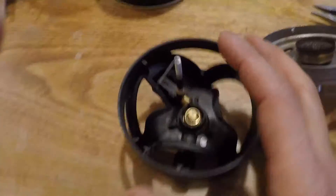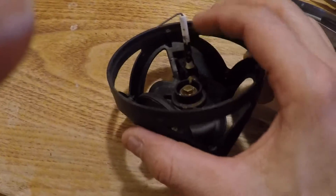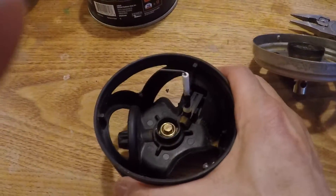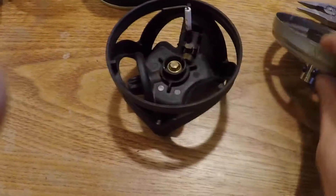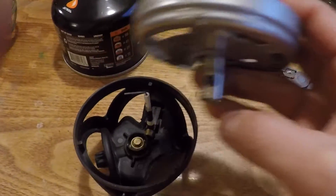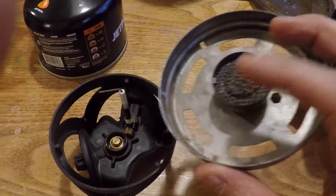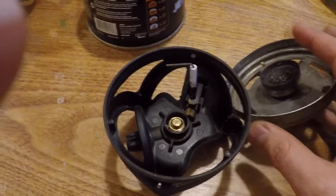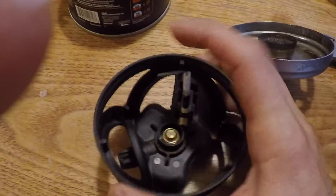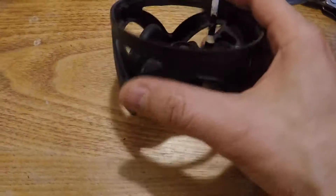That leaves the piezo exposed. This ceramic housing — if the ceramic cracks, what will happen is the spark when you go to hit the piezo will arc out where the crack is and hit on the inside or underneath the metal tower, so it's trying to ignite your stove from underneath instead of on top and it just doesn't work. So if you're clicking your piezo and not seeing a spark come out of the top, there's a good chance the ceramic is cracked.